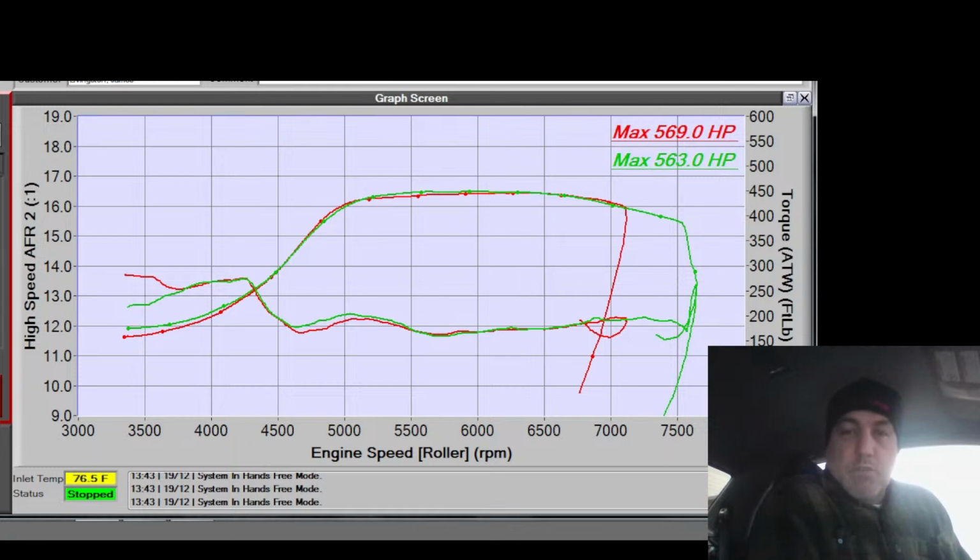Yeah, I think overall though it was still successful. The car runs good. I was really concerned that I spun a bearing earlier. Remember that? But that was because the car had pulled a bunch of timing that I didn't see. Turns out it wasn't that. It was just the timing. It was 3 degrees or 4 degrees less, which would immediately drop you a lot of power like it did. So that was good. Glad that wasn't anything permanent.